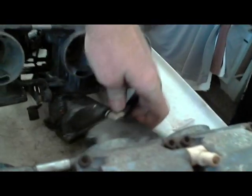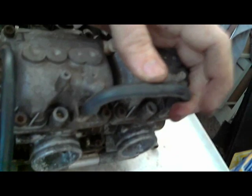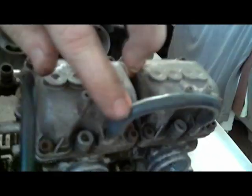And then I'm comparing that to these. So it's the same angle that I had in the other ones. Same thing. They look completely identical on the inside, both Mikuni carburetors, with a slightly different part number. But they are the same. Oh, sorry, with the exception of, and I don't know if this originally came on mine, because mine has these. So this is the float from mine. Maybe not. So it does have this little rubber tube, or it does feel like metal or hard plastic. Can't move it really, but it does have this.